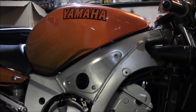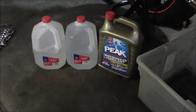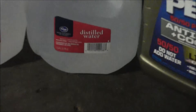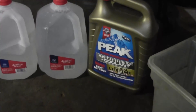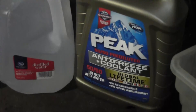Back with the R6, looking to swap out the coolant. This bike is a 2000 and I've never changed the coolant on it, so it's pretty well overdue. What I'm going to do first is drain all the coolant out, then put a little bit of antifreeze in and run almost 100% water. If you're going to do this, be sure to get distilled water — it doesn't have any minerals in it. Got some pre-mixed stuff as well.